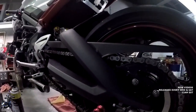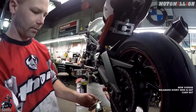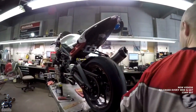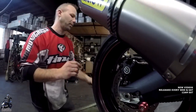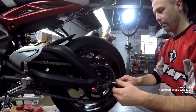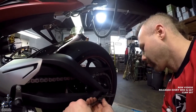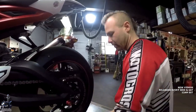I'm just going to measure real quick to make sure the axle is as straight as possible. We got 28.89 — that needs to match. On the other side we got 29.8, so not too bad. We'll just move this one out just a little bit more to get to 29. We got 29.2 — we'll call that straight. Tighten her up.